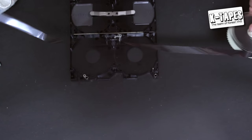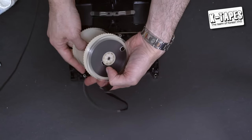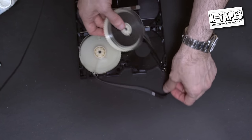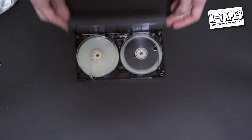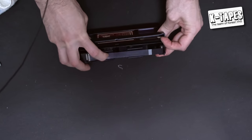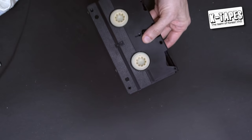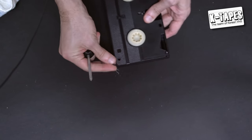For this tape, once seems enough but since it was really dirty inside I'd do it a second time — that's my minimum, because Korean tapes are really nasty. Now put the spool back, make sure it goes down properly, make sure there's enough tension, and close the lid. Open the lid flap so it doesn't crush the tape when pushing it in, make sure it's tight, then close it. Put back all the screws and you're done.